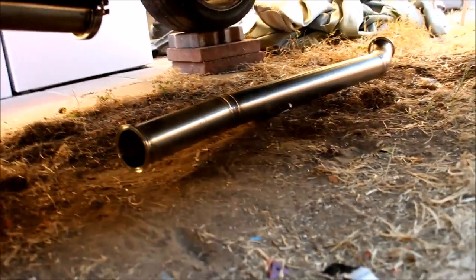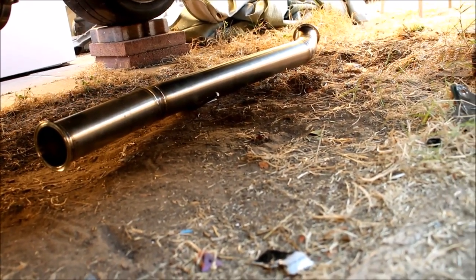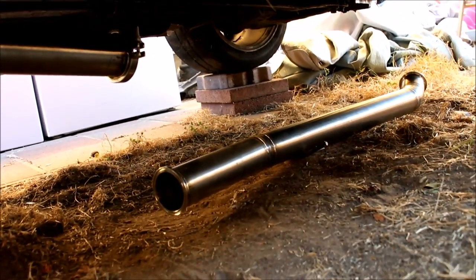There's the bottom of our downpipe, and getting ready to connect the mid pipe. My strategy is to just hang it by the one exhaust hanger — that'll somewhat hold it up in place and support the weight of the system once I connect it to the downpipe.